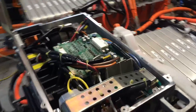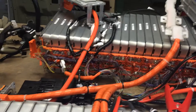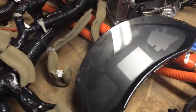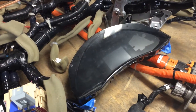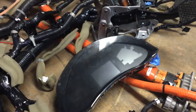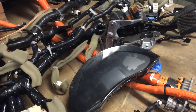I'll quickly go through what's still in place. In the back we have the onboard charger. We've got the whole battery pack, although it's disassembled out of its case and reconfigured — still the whole original battery pack with the battery controller, the LBC. We've got the BCM still in place. The lower display unit out of the dash also surprised me: I was unable to get the vehicle to power on without it. I think that's because the speed signal is sent from that unit to the BCM.